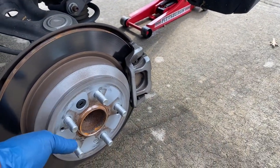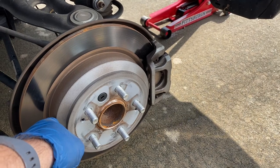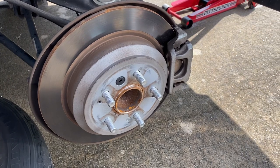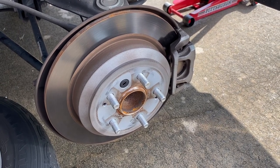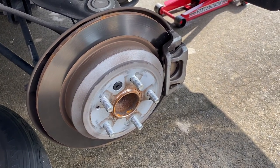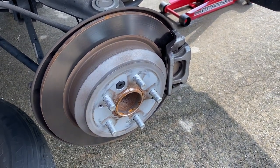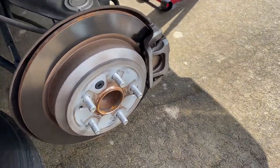This is a drum and disc brake design. The drums handle the emergency brake. There's nothing special about the emergency brake — it's not electronic, so I can just push the pistons back. If you had an electronic one, you may have to use some sort of scan tool to put it in a certain mode, or disconnect the power wires. It's really specific to each vehicle. If you don't do that, you can damage things. This one isn't electronic.